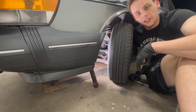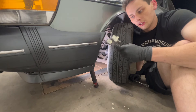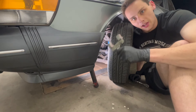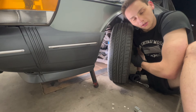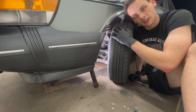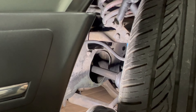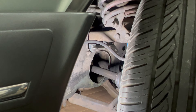Let's move on to the front. There are three things we need to do before starting on the front suspension. Number one and most importantly, installing our lower control arm axle removal tool, which makes getting things like ball joints and the axle out much easier. Second, we need to break loose the axle nut — we'll need to remove the axle partially to get access to the lower ball joint. This tool sits right in the slot in the body behind the brake line, and when we jack up the car it keeps the suspension set in a place that makes removal of parts much easier.